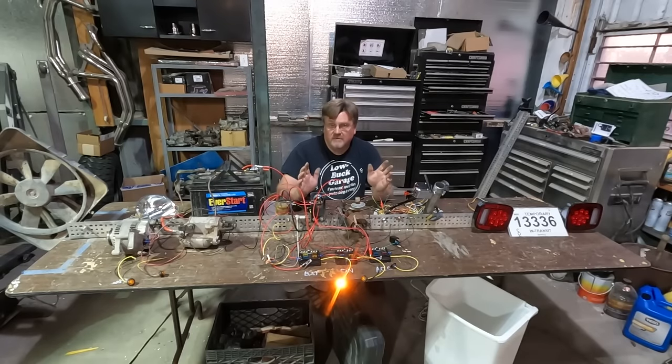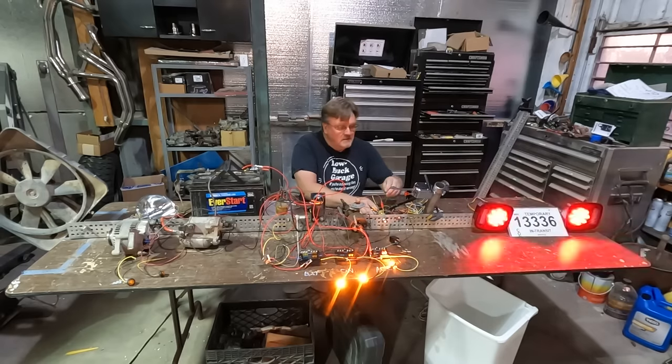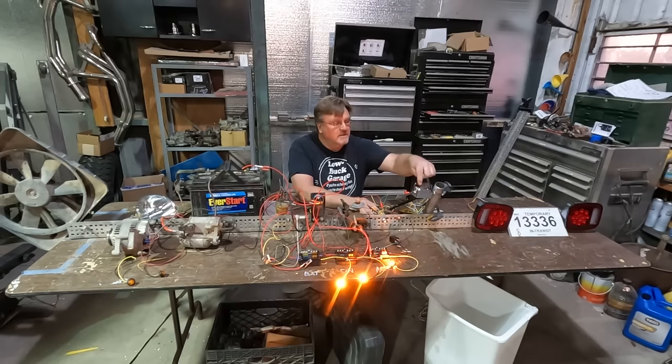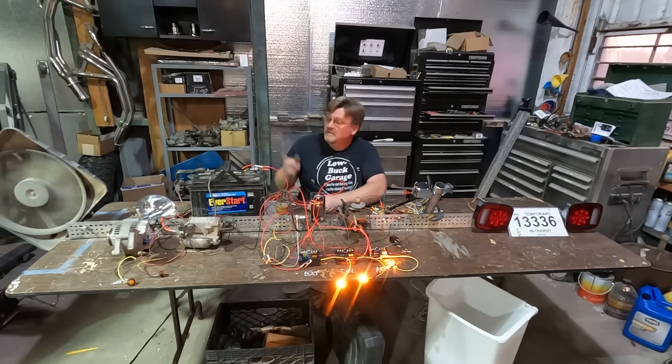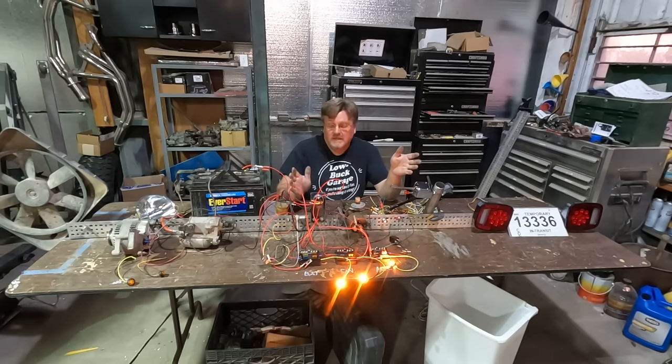Wiring is a complicated subject and you could go on for a long time with more details, but I wanted to give you a basic overview of what you need. I've got my system ready for my truck — I can turn it on, start it, drive it. I've got spark, brake lights, headlights, high and low beam running lights, signal lights with the properly working indicator, and a fan if I want it on a relay. I have plenty of room in my fuse boxes to add anything else, like work lights and fog lights. This is the whole basic concept for an awful lot of projects, and I had a lot of fun experimenting with electricity and learned a number of things — a little more than I wanted to know about signal lights and flashers, but it's good to have. I hope it helped you guys out along the way too.